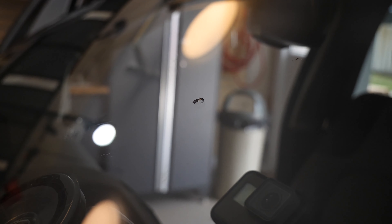We have our last one. We're going to pull off our contact sheet and peel off the excess resin. I'm going to peel at a 45 degree angle until I get around the actual crack. Once you get around the actual crack, they recommend that you scrape at a 90 degree angle. Wipe off the excess resin — and that looks great. That last repair, frankly, looks amazing. The resin from the Rain-X kit is extremely clear and it is nearly undetectable from about a foot or more away from the glass.